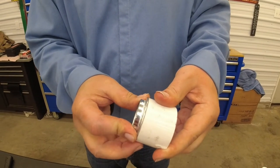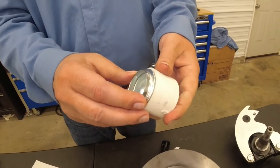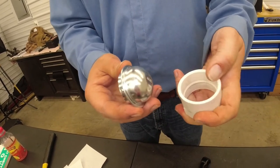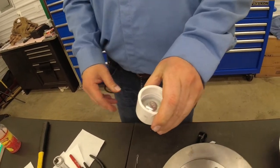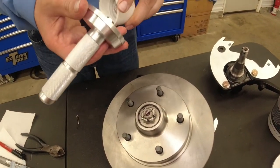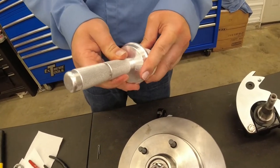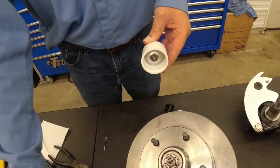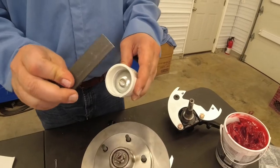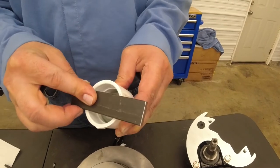This is not going to damage the plating. So clean it up a little bit, put it on there, and you can use your same seal installation kit — there's still plenty of room between the hardware and the top, so it's not going to damage it. You can use that to drive it on. You're already set up here because you just did the seals a little while ago. Or if you're on a budget, you can use a little piece of quarter-inch or five-sixteenths strap and tap it in — same thing as putting the seal on earlier.